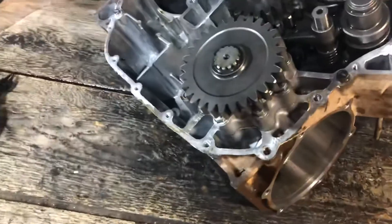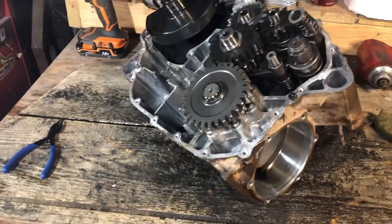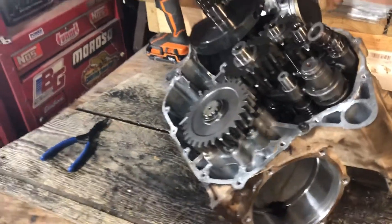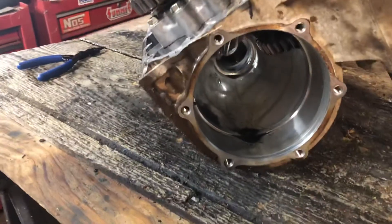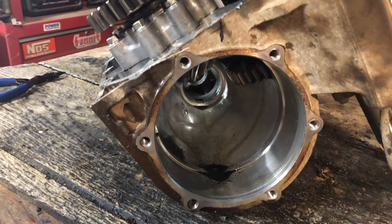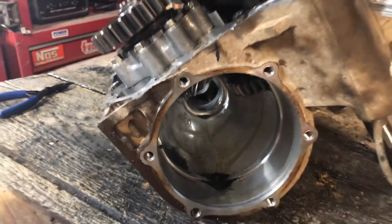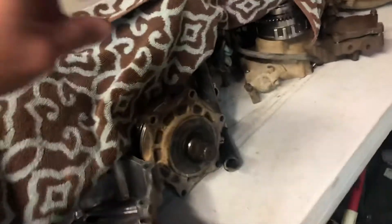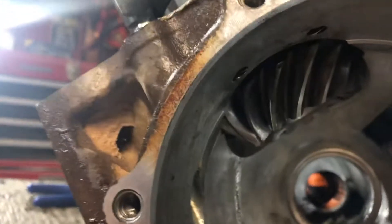Tonight we're going to remove a couple items and try to get that gear chunk out of the engine case to see if it's a bad bearing causing the slack, or if the retaining nut has backed off. To just get to the six-bolt flange for your output shafts, you don't even have to disassemble the motor — you can remove that flange while the engine is still inside the Teryx and feel for slack on this gear.